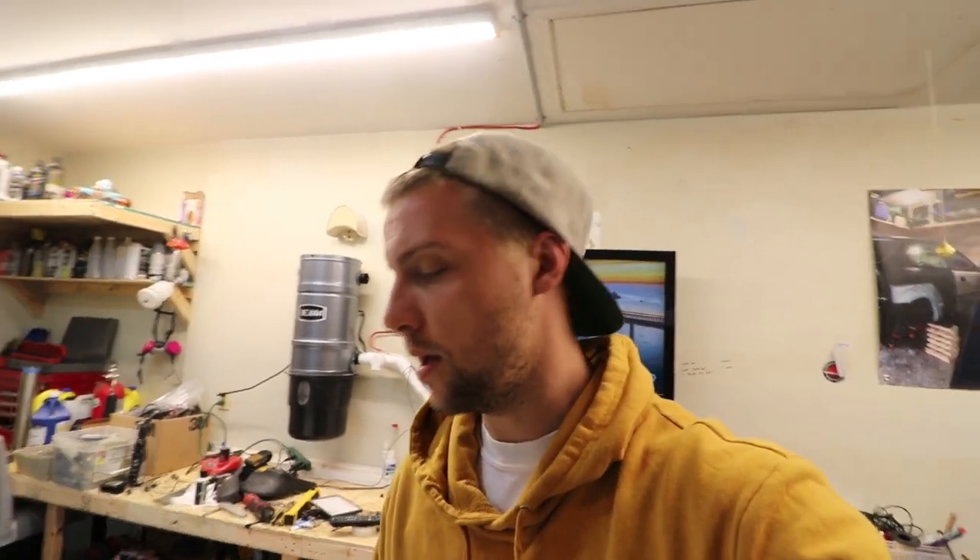With the car washed, I'm going to go ahead and start polishing it up. I'm not going to go super extensive to make this car look incredible — I'm really just going to knock away those 1500 and 2000 grit scratches and that's about it. I'm not making this a show car, but I do want it to look nice.